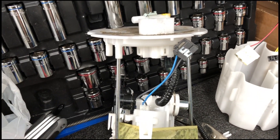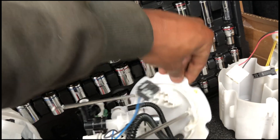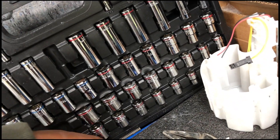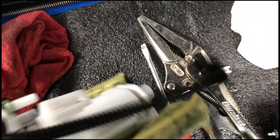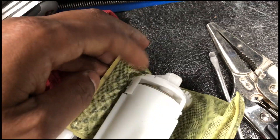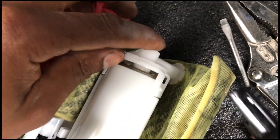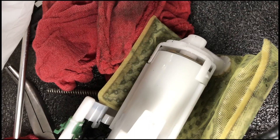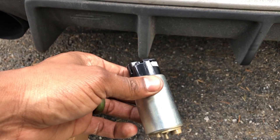The fuel pump is inside up there, so it looks like I've got to get the fuel pump out from the bottom. The bottom has little tabs - you unclip them and then the bottom slides out along with the fuel pump filter.